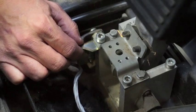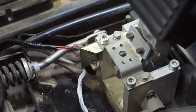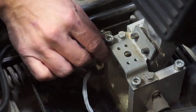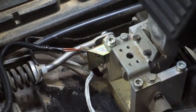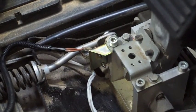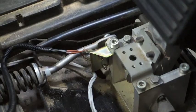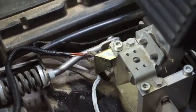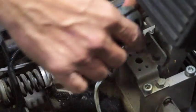You want your brake switch so that when the brake is depressed, the switch should be made. Right now it's set perfectly. You want basically about a quarter inch to half inch of travel before your brake is activated — that's exactly what you have right there, so that's a good positioning. Go ahead and lock down the 10mm hex head bolt, then the cap head screw — it's an 8mm — and lock that down.